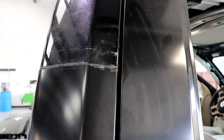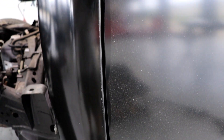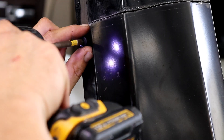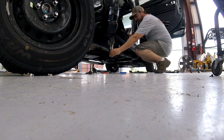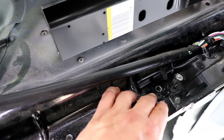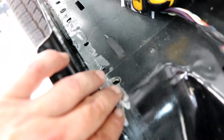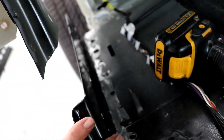Starting from the top down, we're going to check our gaps. Other than the line right here, I see no difference in the gap — which is fantastic, a nice gap all the way. We're going to leave the door in place for now, take off the top two sections, then weld in that third section which is the main support piece. We'll have to remove that third section to get access, clean up the areas, and drill spot welds where we need to. We can put it right back in the same spot because it's now located by all the screw holes. These are all the factory spot welds I had to cut out using a spot weld drill, and these screws are what's going to help us locate it back in that same position.